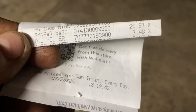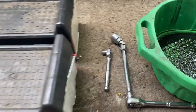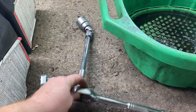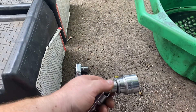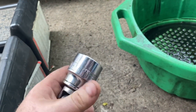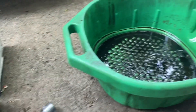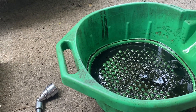With decent oil and a decent filter, here's everything you're going to need: some ramps to drive up on, a three-eighths wrench with a 13 millimeter socket, a half-inch drive with a swivel about a foot long, and one inch and one quarter socket — that's to get the filter cartridge out. You'll also want some type of pan to drain everything into.